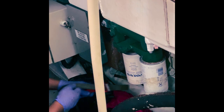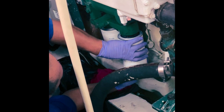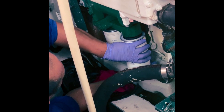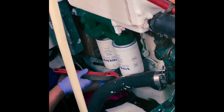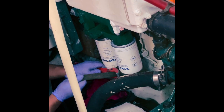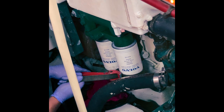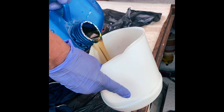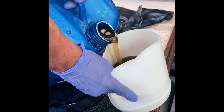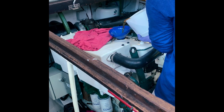The other filter goes on — not as easy this time, but we're on. Just hand tight and then nip it up with the strap wrench, and we're good to go. Nearly time to fill up with new oil. We put the oil in with an intermediate container, just three or four liters at a time — just helps control and not spill the oil. In nice and slowly.